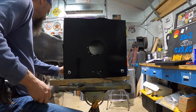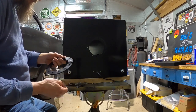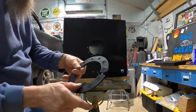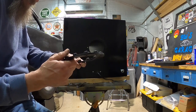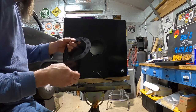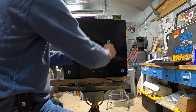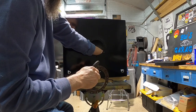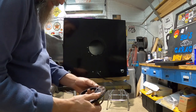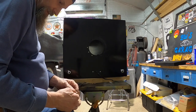Now all we're going to do is put it back together. The next part is to put this flange piece back in and put the fill neck back on. We are lucky that these have metal nuts in there — I could have sworn they were plastic threaded last time. I imagine if you messed with it too much you could get it spinning and mess it up, so we still want to be very careful. It is a split piece, so you just split it to roll it in. I'm going to start a couple bolts on four sides of this to keep the gasket from sliding all over the place.